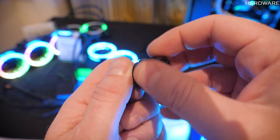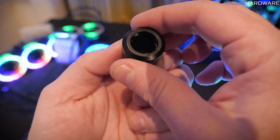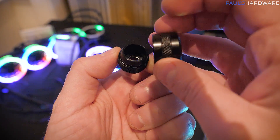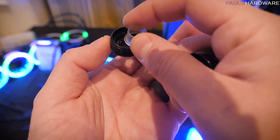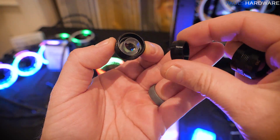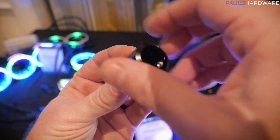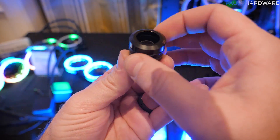Check out these new AlphaCool fittings — their new premium ones, especially for use with PETG tubing, which can flex a little and be affected by the pressure of the O-rings inside. They've redesigned this — Dave actually worked on it himself. There's an inner O-ring at the bottom, then a plastic insert that pops inside to keep the end of the PETG tubing from getting crushed. Then a very thick O-ring drops in outside of that, providing a much better seal on both the fitting side and the cap side. You screw the cap on — lots of very thick threading, really smooth to attach — and these are AlphaCool's new premium fittings.